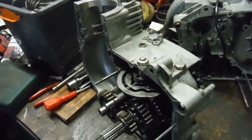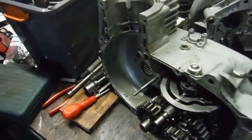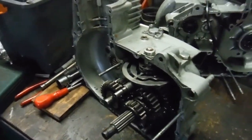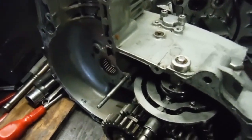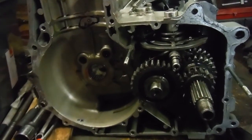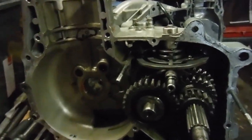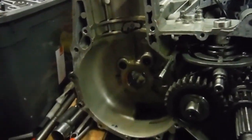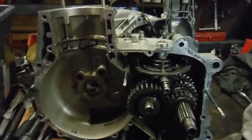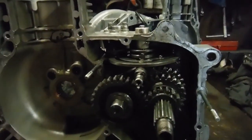There was a little bit of play developing in the big end. It turned out that the bolt securing the engine sprocket, starter sprag clutch, and everything onto the end of the crank was not only undone but out and in the bottom of the primary chain case. So the crank could move side to side by nearly three millimeters — quite some end float — putting side thrust loads on the conrod, big end, piston, and causing advanced wear on them.